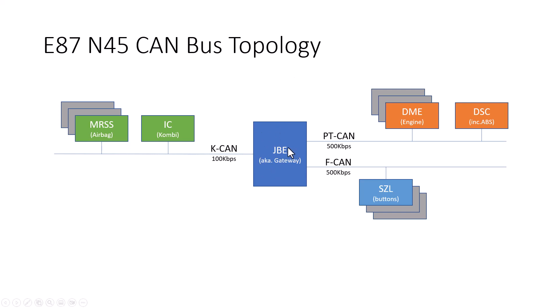There are lots of different control units attached to these various CAN buses. There is a way to send requests to one of these control units and get a response, but most of what I've analyzed so far are asynchronous notifications. What I mean is that a unit like the DME just throws a message out onto the CAN bus repeatedly. The message has an identifier, and if say the DSC was interested in that identifier, it would copy it into memory and process it. All the other units do exactly the same — they simply throw messages onto the various buses.